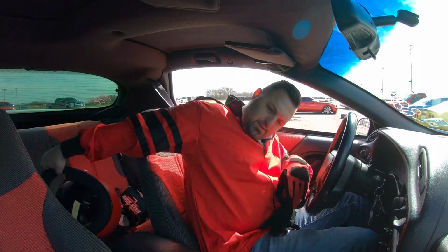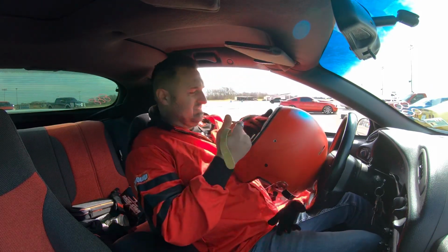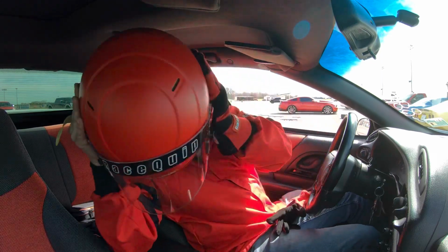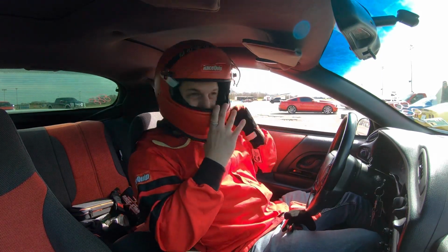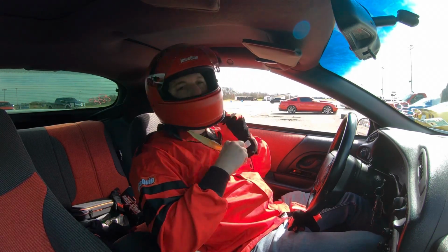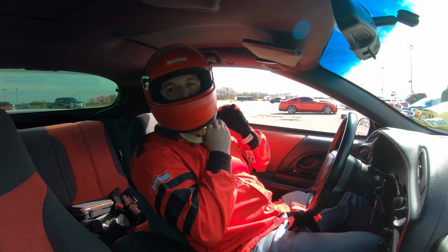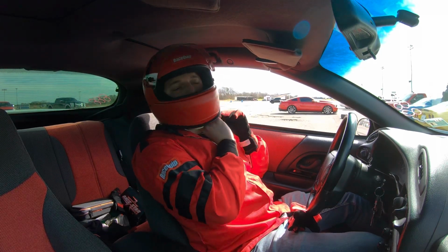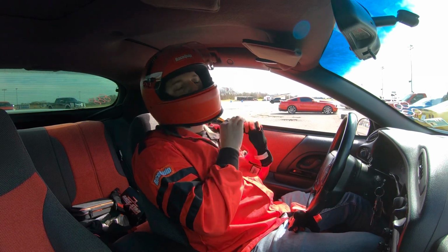All right, so I looked at the data log on that little NA pass and it was rich. Like a 12.40, so I leaned it up 5%. Should bring it down to about a 13.0 or so. And we'll see what she do. Come on now. There we go.